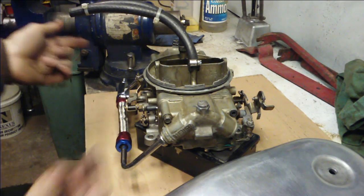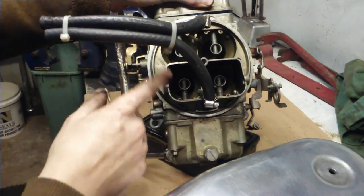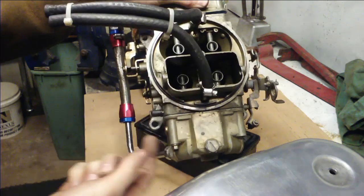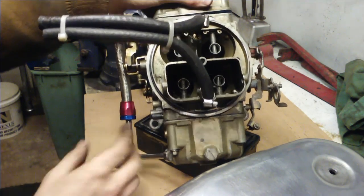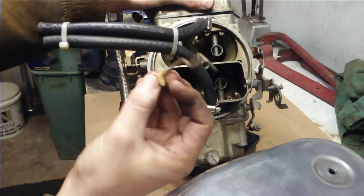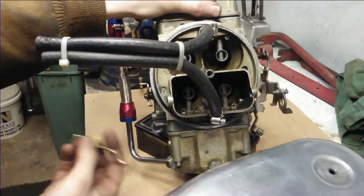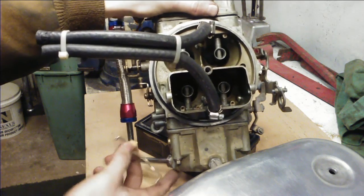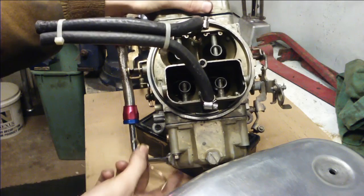The next thing I did - you obviously don't see a choke plate in there, so you have to take that out. Not just because it'll be a restriction with the boost, but there's an arm with a plastic piece that goes through a hole. With turbo application you have to try to get everything as sealed as possible, so you have to fill that hole. I used JB Weld, which is kind of like a fuel-resistant epoxy, and it works very well. You have to fill that hole or else all your boost is pretty much gone.